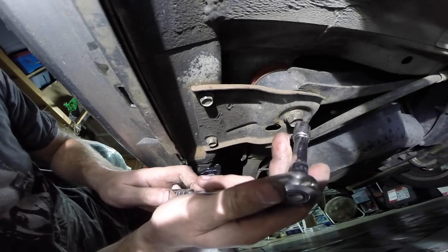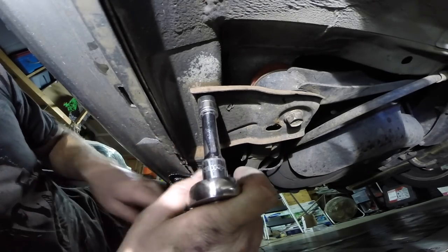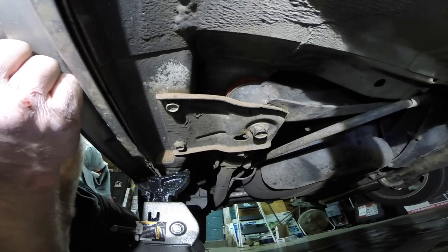My GoPro SD card was full — what you guys missed is I pulled the metal plate straight off the top. So I have my new bushing and the metal piece sitting right on top of it, and I'm going to sandwich it in between this brace. That looks real good — fits nicely. I'm going to make sure it's even on all sides and put the bracket back on — boom, bada boom. The bolts go all the way up and start threading in. Torque the 12 millimeters to 25 foot-pounds and the middle 17 millimeter to 100 foot-pounds.